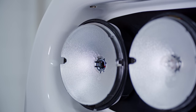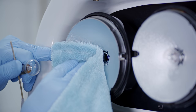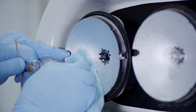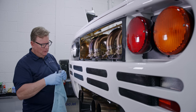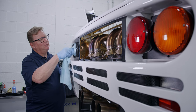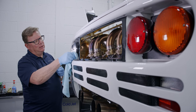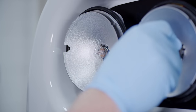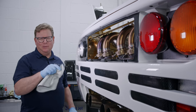These reflectors are plastic and textured, so you can get away with using a quick detailer on them. On most other cars they're actually smooth and a lot shinier — sometimes chrome, sometimes silvered. If they are silvered, there's a whole different process: you use mostly glass cleaners and have to be very careful not to take the silvering off. Silvering is very much how they make a mirror — there's an actual silver film applied to the back of the glass. We've cleaned this area up pretty well, so let's go over to the bench and clean up the lenses themselves.